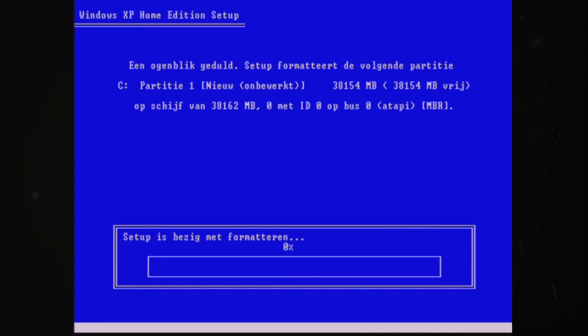Just a quick reminder for those who haven't actually seen the previous video, this is a Compaq iPaq, a legacy-free desktop PC from around the year 2000 to 2001, and it features a 500 MHz Intel Celeron CPU and 256 MB of PC133 memory. One of the memory sticks actually died in between these two videos, so I put in a Micron kit of 256 that I had laying around. So now it's working properly again. Hard drive is still fine. It's a 40 GB Maxtor Fireball, not a Quantum, but actually a Maxtor Fireball drive, running at 7200 RPM, I think. It's a pretty zippy drive overall.